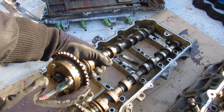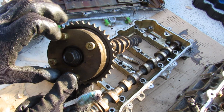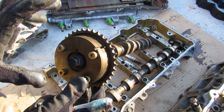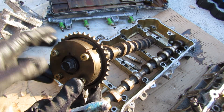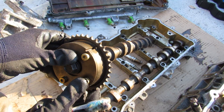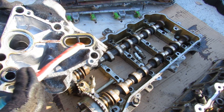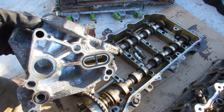The camshaft tray and camshafts themselves are a nice solid piece. The variable valve timing system phases the input from the timing chain to the output at the camshaft. One downside to many Toyotas is that when the VVTi system wears out it tends to give a rattle on startup especially when cold — I've got another video on that linked above. The water pump is also a weak point on some of these engines, and one thing I don't like is that they ran a main oil galley through the water pump housing for no apparent reason when they could have just routed it through the block itself — just makes for another failure point.